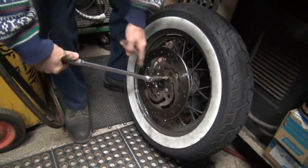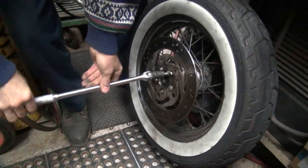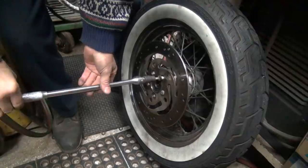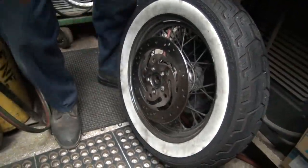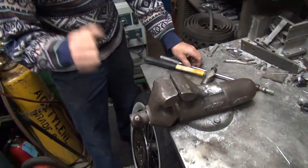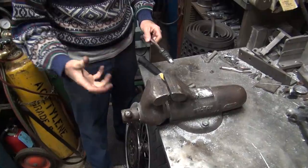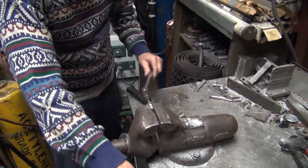Next, we're using a gold Snap-on bit, which is the strongest one out there. Now, the zip gun works good, too. The half-inch zip gun, not a 3/8. You want the heavy knock of a half-inch. You want to get a couple good knocks, and then unscrew, not beep, beep, beep, back and forth forever. Which is what a 3/8 would do.